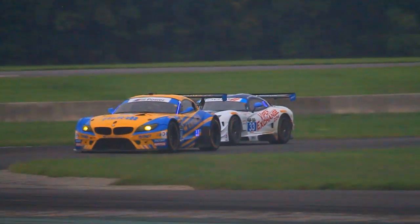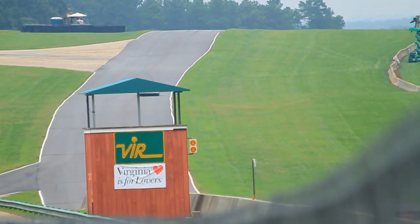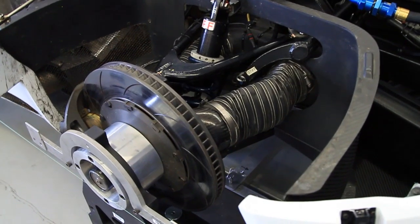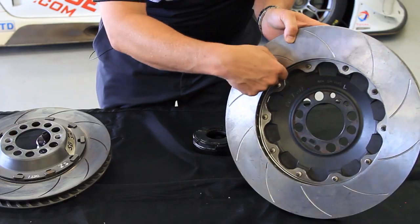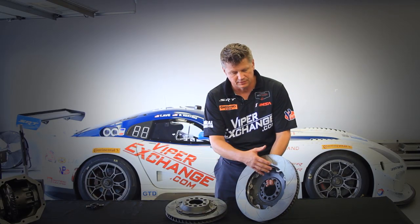If you were going to go out with this race car with slick tires and all that grip and all that power and race this car on the track with street brakes, they wouldn't last very long. The main differences between a race car brake package and a street car brake package is: one, the amount of cooling that's actually in the brakes; the weight of the brakes, because you actually want to make it as light as possible. You can also see with the backside of the brake rotor, the air actually goes in and comes out very cleanly — you want to have as much cooling to the brake rotor as possible.